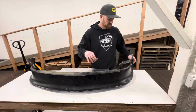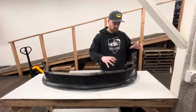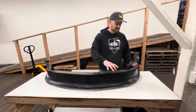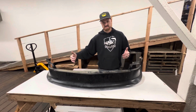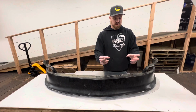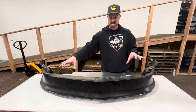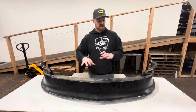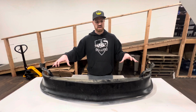But anyway, what we found works is that with it loose, without that tension, you can adjust it to get the reveal even and get your air dam symmetrical to match the splitter. Once you do that, often you can tighten the turnbuckles and create that pressure underneath this air dam, and cause it to sit and stay in that symmetrical state.